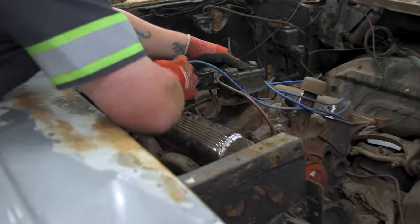Who would have thought this would be an all day thing just to put a gas tank in? We've got our ground and signal wire. As soon as Justin gets back we're going to put our hose clamp on and it'll be ready to install. We've also got to remove this steering arm and tie rod. We've got our hose clamps - me and Hillbilly are going to get this tank in. We've got all the vent lines and fuel lines ready. The very first assembly is all installed and tight. We're going to get these all cinched down, get the pinion angle set, make a mark, pull this out, weld the perches - we're building this rear end.